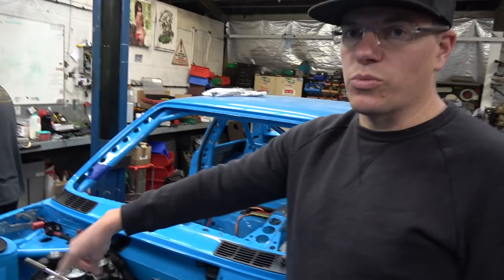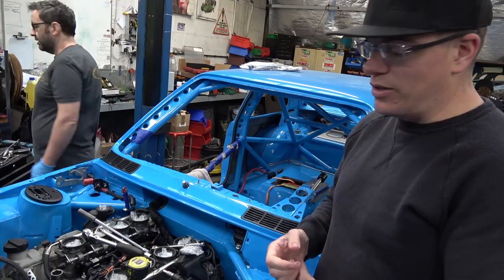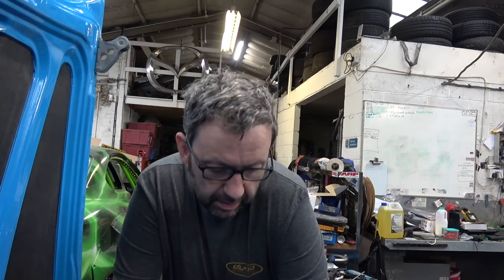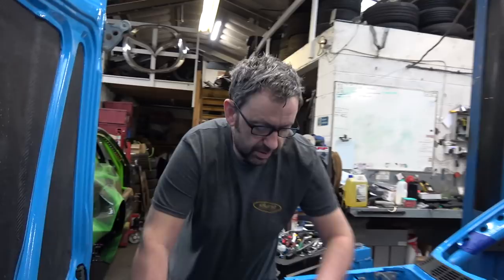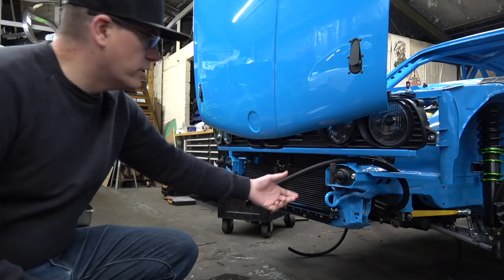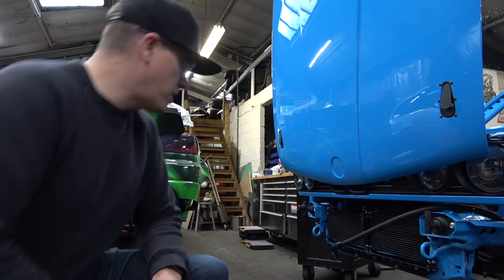We're literally just doing little bits of wiring here and there. At the moment we're making sure we've got the correct pressure signal for oil pressure, so we're replacing the oil switch in the front of the V with an oil pressure fitting and then running dash three lines - so having externally mounted fuel pressure sensor and oil pressure sensor running wires. Got some oil cooler lines done last night, gearbox oil cooler lines done. Some of the routing for the gearbox oil cooler and the engine oil cooler are in - we need to finish some grommet sorting, but progress is here.